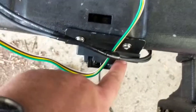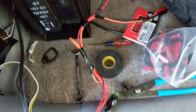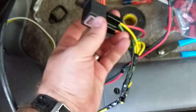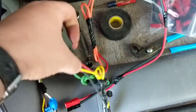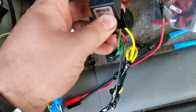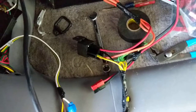Looking at this relay: the red wire goes back to the battery, or your power source. The orange wire is going down to my 12-volt supply to the 7-pin connector. We also have a ground connection. A relay is just a switch you can turn on electrically — there's a little coil inside. When you apply 12 volts to the yellow lead — the black ones are ground — it closes the circuit, so electricity flows from the red wire through the relay to the orange wire going out to the connector.